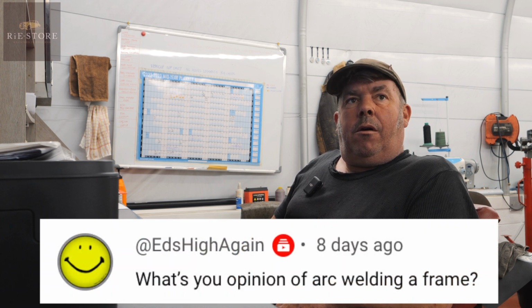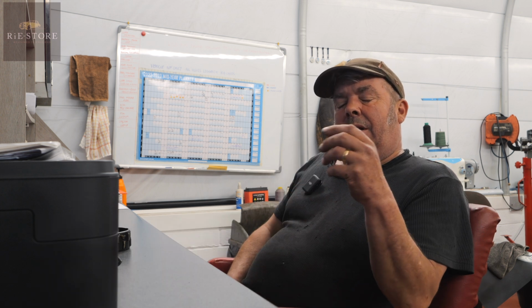Ed's high again, and he says, what's your opinion of arc welding a frame? The trouble is, if you're just talking about the tube, yeah, arc welding is pretty much as strong as anything, as long as you can arc weld. But if you're welding a tube into one of the cast iron bits, you can do it. You just use dissimilar rods. I can't remember all the rod numbers now. I used to do a lot of it. But if you get dissimilar rods and heat it up first, yes, you can do it. But not the best idea trying to weld mild steel to cast iron.